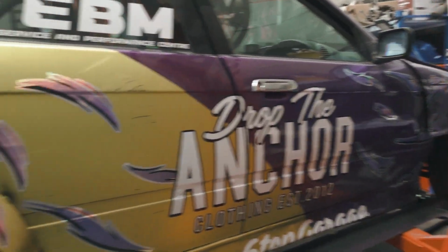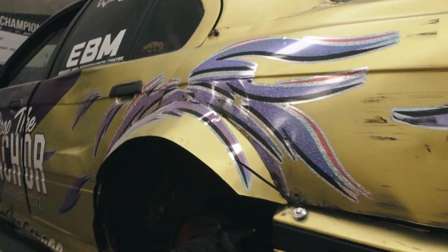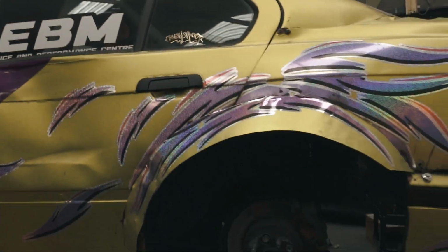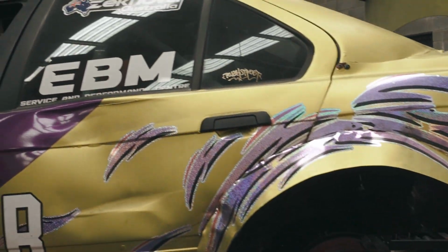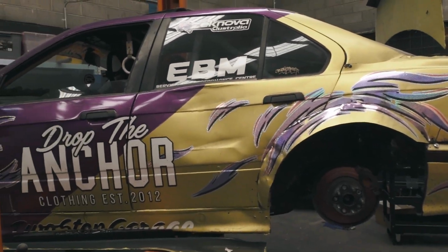This side's looking pretty good, so we're happy with that, but the other side, we need to go ahead, cut the tacks off the flares, open the door because it's four door, but we weld the flares over the doors, and push the dent out of this door, straighten up this flare. Not gonna do too much, but just make it a little bit more cosmetically beautiful.